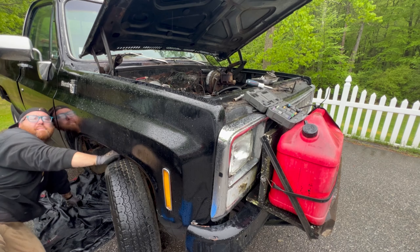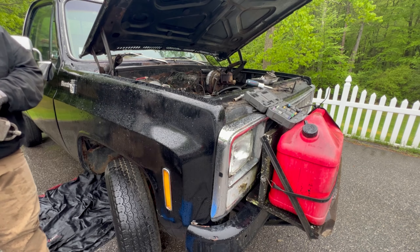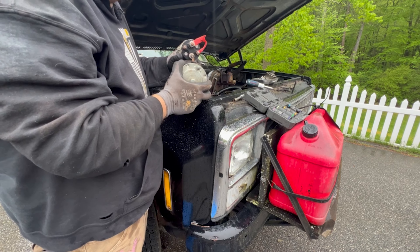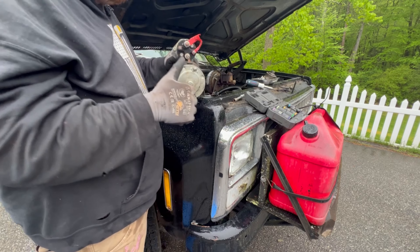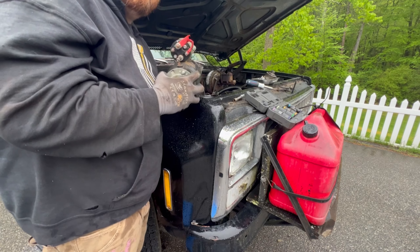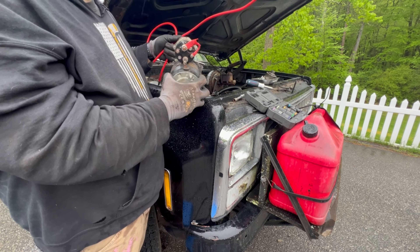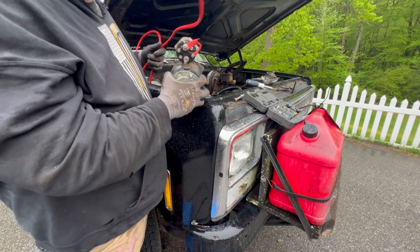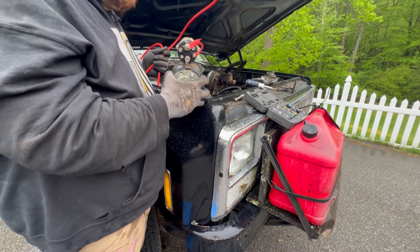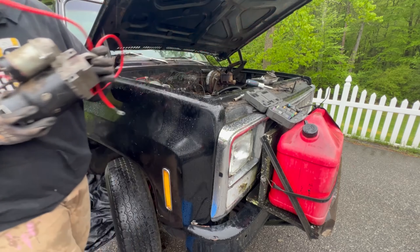So I found something that may have contributed to our issue. Did you disconnect that wire before I took the starter out? No — well, it disconnected itself from the crimp. The crimp job came off. So did the jumper. Is that the problem? Probably a problem.